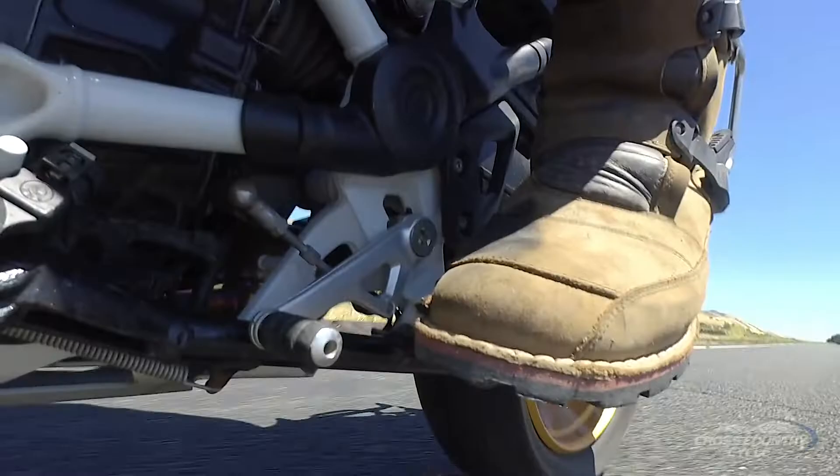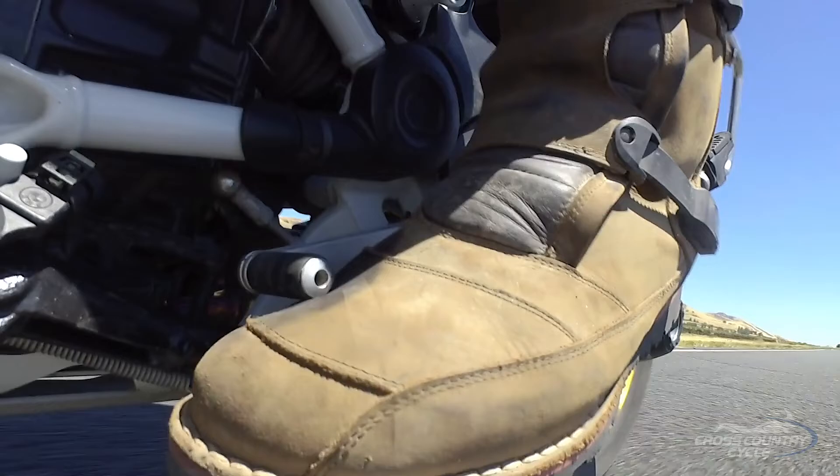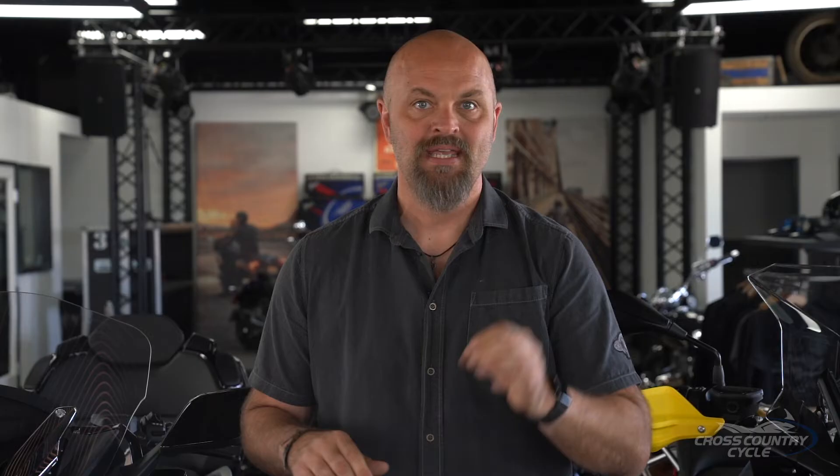One last piece of technology you may have on your new bike is Shift Assistant Pro. It allows for upshifting and downshifting at virtually all engine speeds without using your clutch. When you're accelerating and ready to upshift, simply place your toe under the lever and firmly and briskly press up — the bike will upshift without the need to let off the throttle or pull in the clutch. Similarly, you can downshift without actuating the clutch while decelerating — press down firmly and briskly on the gear shifter to downshift and release once the gear has been achieved.